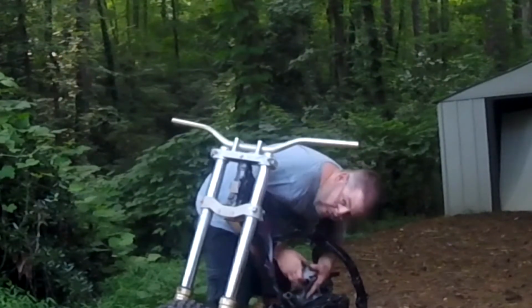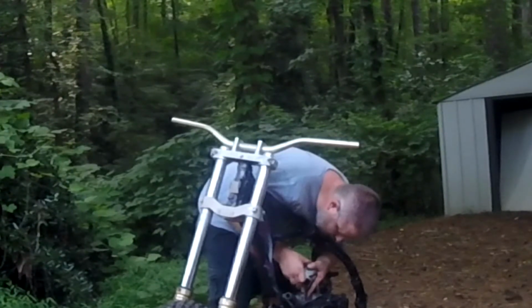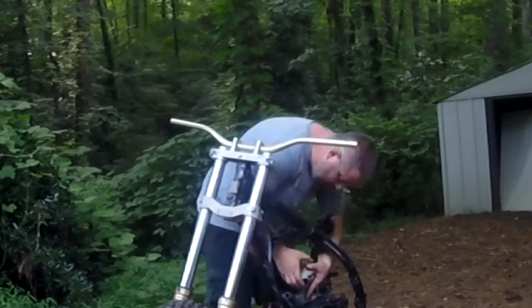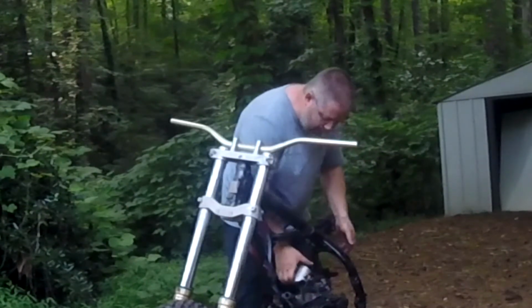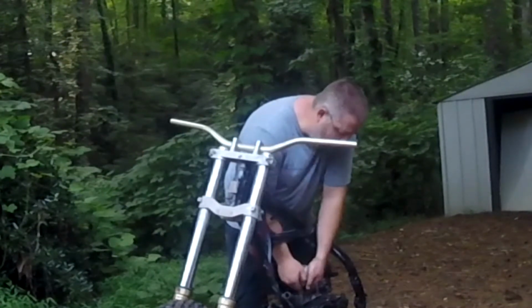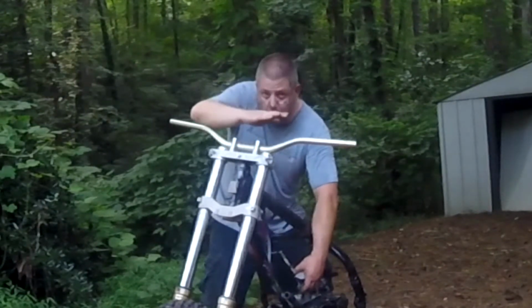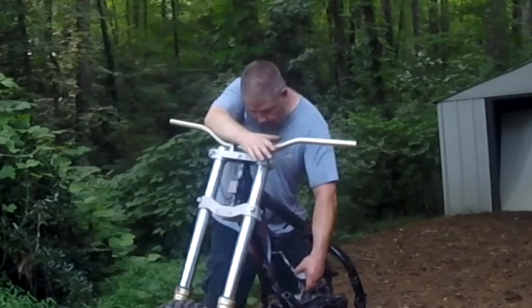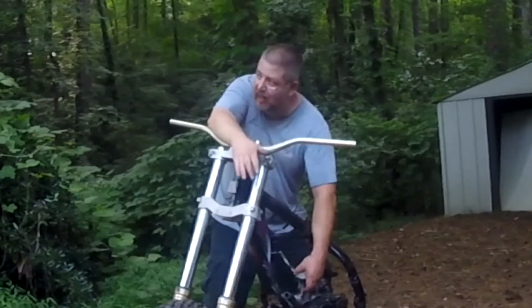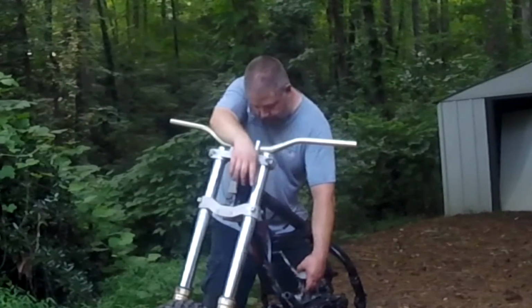Now, that's the most important thing, and what I want to accomplish today is check this rod. It's got angular side to side like they all do a little bit. But when I take up the play with the piston and the rod by doing that, because you know right now there's play in the piston and the rod, you can't feel. When I take that play up and pull up and down, I'm looking to see if I can get that whole rod to move on the crank pin. They all slide a little bit side to side. They all have a little bit of angular movement, especially when they're used like this one is.